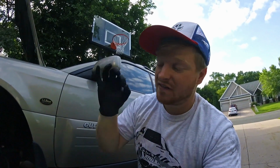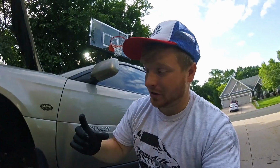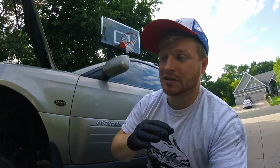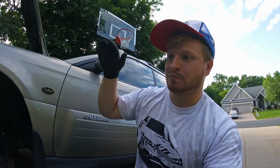So, get good struts and pair them with a lowering spring, and then spend the money that you would spend on coilovers on really fat sway bars and really hard polyurethane or minimum aluminum sway bar end links. Now, I've talked about this in previous videos, but this is the goldenness of a lowered car. You'll still get good rebound on your struts. You won't have freaking hardwood suspension, but you'll still be able to corner at speed and not have body roll.